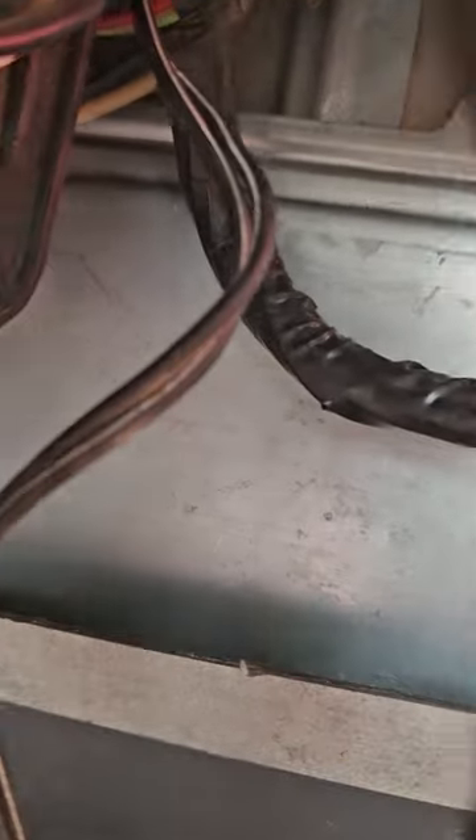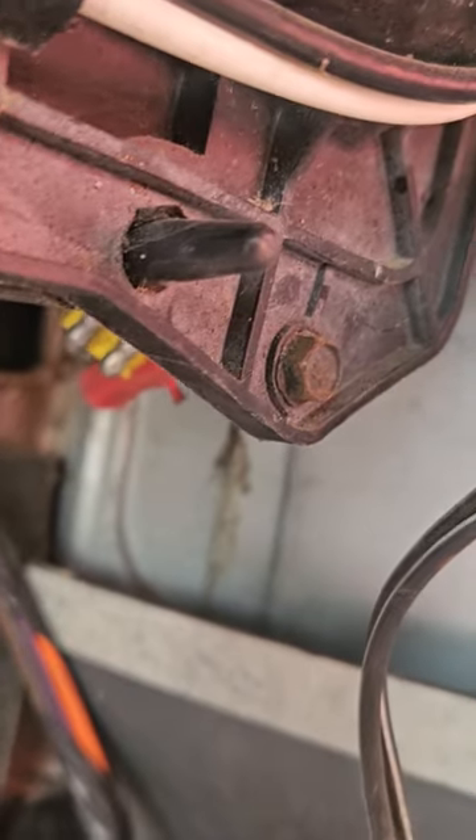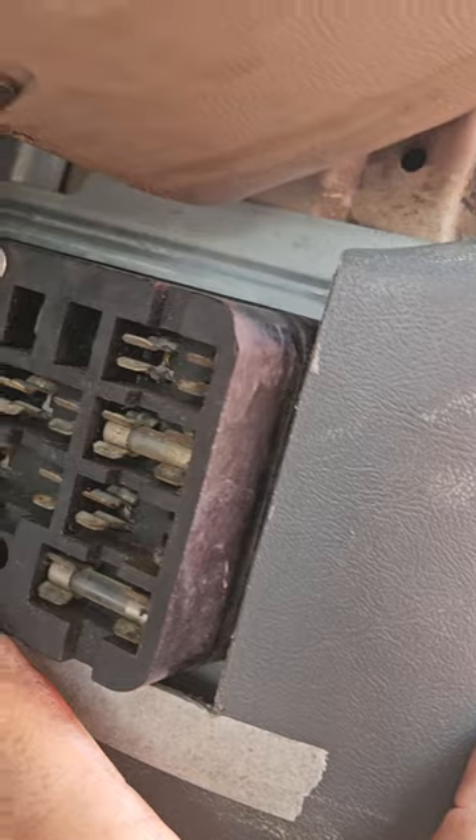So if you see in here, you see how I have this galvanized plate? There's a hole there and it's uneven and shitty. See how there's a line in the galvanized plate there? I took one out of a parts truck, flipped it around, and turned it sideways. So now we have — see the edge? It's a nice flat, even, perfect mounting spot for this.